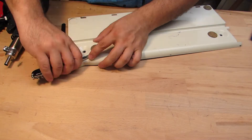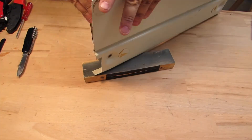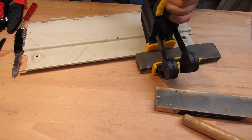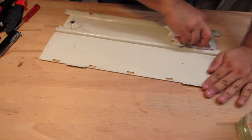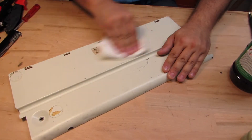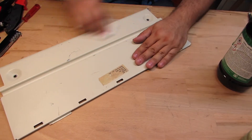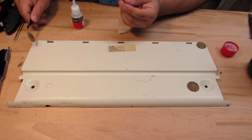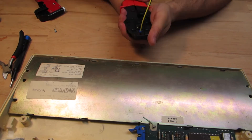For the cork feet to be removed, I apply some heat with a heat gun. I will also try to bend back the steel plate into its original form — I must be gentle though, as I don't want the original paint to peel off. After cleaning things up a bit, I re-glue the cork feet back into place. The keyboard originally featured a ground wire, though it was disconnected, so I make a new one.